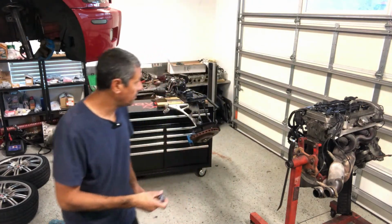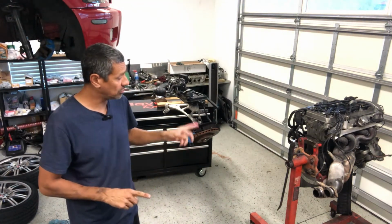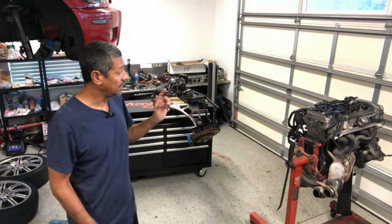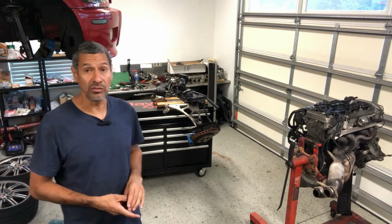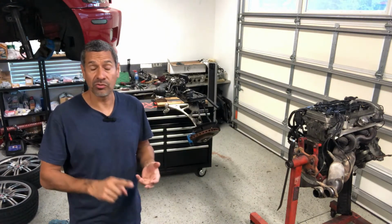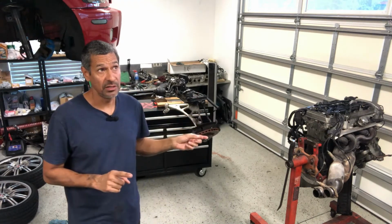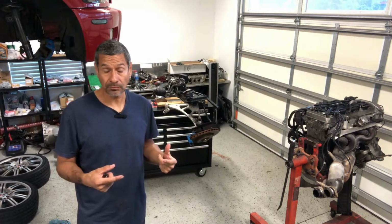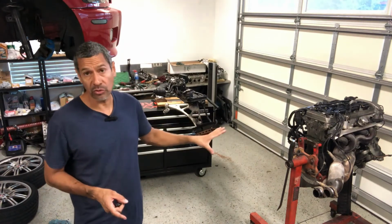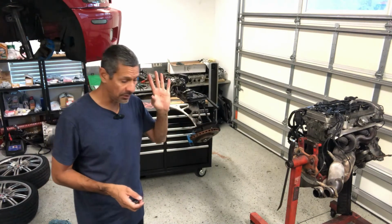And then the engine itself, we're going to do the rod bearings. There are some ARP bolts, some seals, and we'll replace the oil pan gasket while we're there, of course, and the front and rear main seal. And the other item we're going to be doing is the Vanos Upgrade. So the Vanos Upgrade is going to be all the seals that are in there, all the updated bolts, the M5 springs, even the bolts more behind the exhaust and the intake hub itself, those bolts right there. So yep, she's going to be ready. I know there's a couple items we're going to replace while we're at it as well, but those are the items that just come to mind.